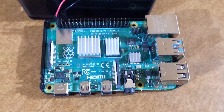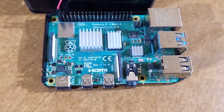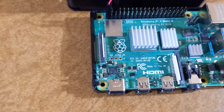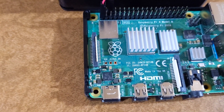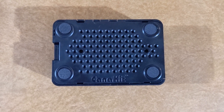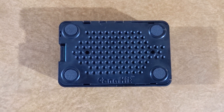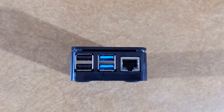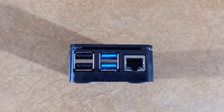Install the motherboard on the bottom half of the case and make sure to get it underneath the black tabs on one side. Do not force it — be gentle, and it should click when you get it in there correctly. Your ports should line up: USB and network ports should be lined up.